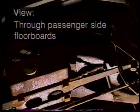So we're going to remove the master cylinder. The first thing we're going to do is remove the hydraulic fitting from the front of the master cylinder, so we'll do that first. Can't really get too much each turn, so it takes a little while to wind the fitting all the way out. We are out of there. So what we'll do is we will pull the cylinder off the pipe rather than trying to pull the fitting out along the pipe because it's seized up.